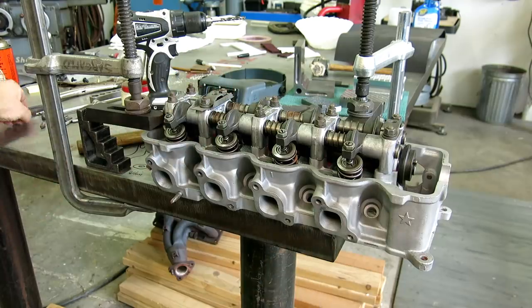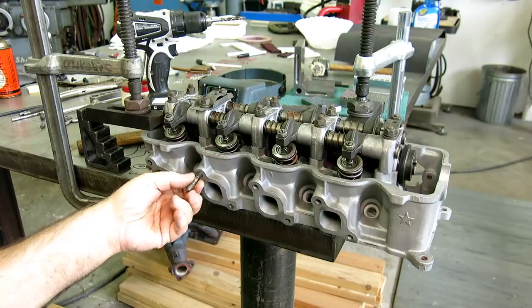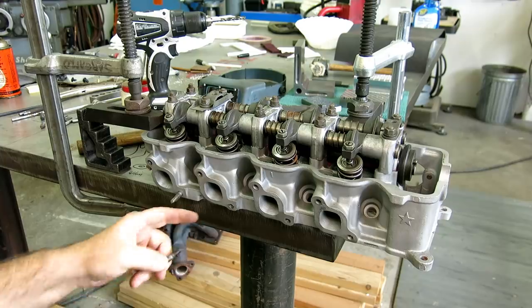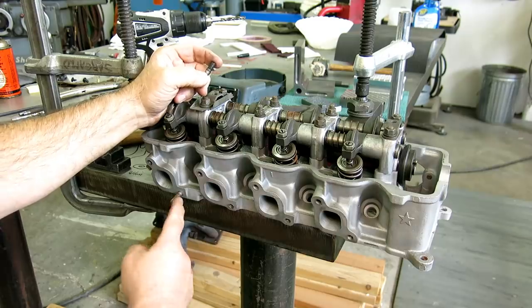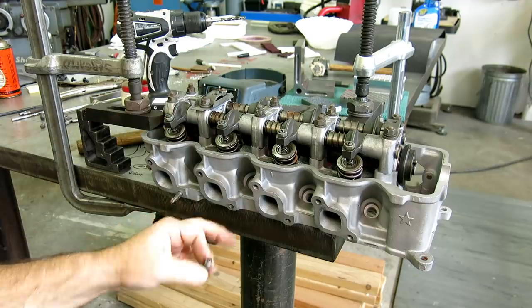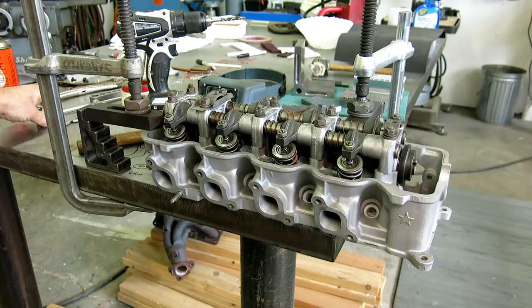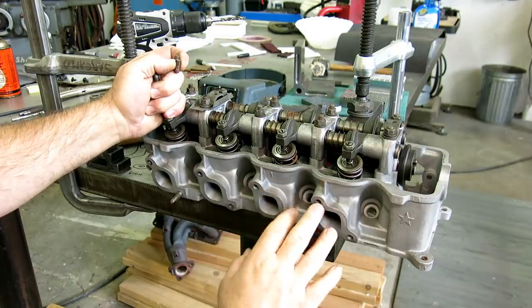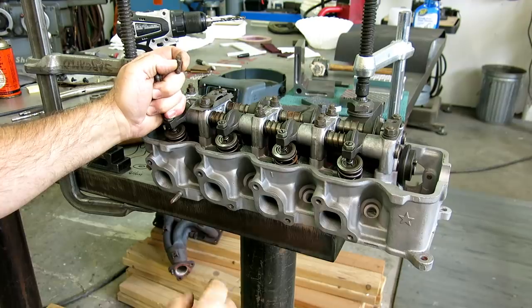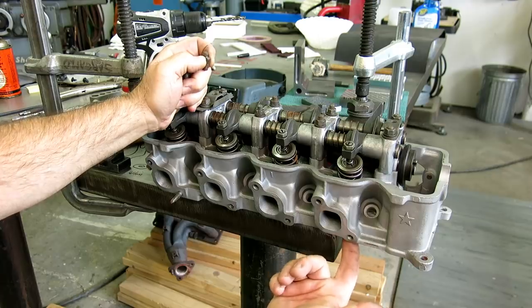Anyway, this is the exhaust manifold. I had a bunch of studs in here that were not cooperating. So I'm helping him get the studs out — you shoot a little bit of video with it too. I'm kind of down to the last one. It's a pretty straightforward job here, actually, and it would be a lot harder if it was in the car. So here's what actually happens — these upper ones came out really easily. These lower ones are a little trickier because they actually project into a cooling passage in the head.